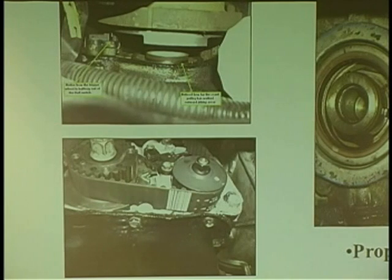So why even have the keyway there? For the guy, you should put a long keyway and hold both on the keyway. They didn't do that. So you push the gear all the way back, and what held this plate to the gear was two little nipples. The nipples kind of sheared, and it moved on him. So he's finishing the job. He never placed the trigger where it was supposed to be.